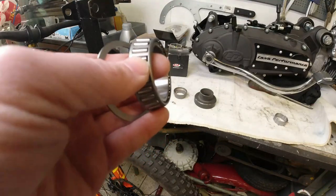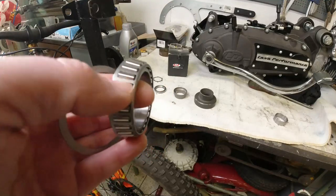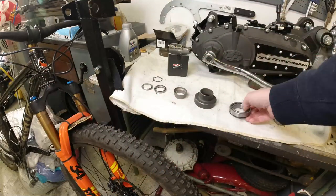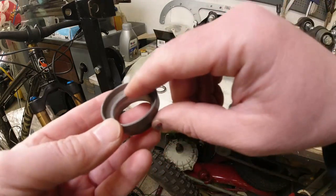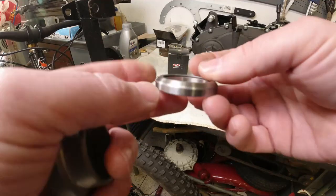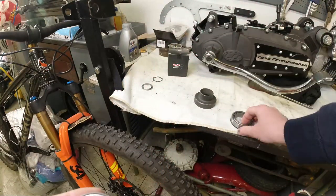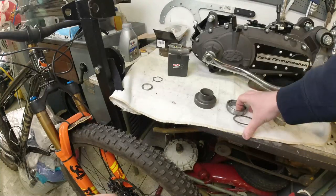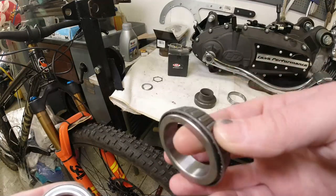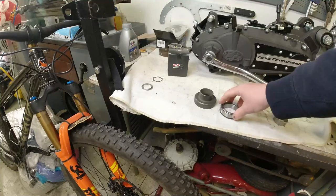I've had these on the top and on the bottom. The problem with the classic scooters is the fact that we don't have a lot of room. So what we get in this kit instead of a roller taper bearing at the top is a cup that's been especially machined with a taper at the bottom for a normal standard bearing and a seal bearing. The nice thing about this is it's probably really easy to swap out if it does get destroyed. The whole brunt of the front brake forces get transferred more on the lower bearing race. If we're lucky, these will probably outlast both me and the scooter. I'll do a bit of a road test on it once I've fit it.